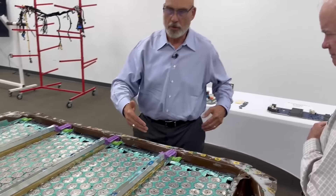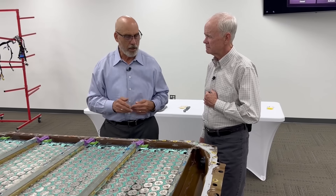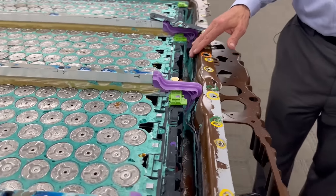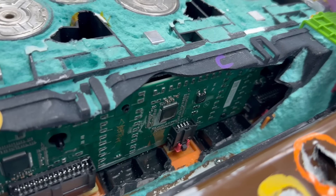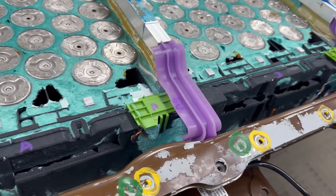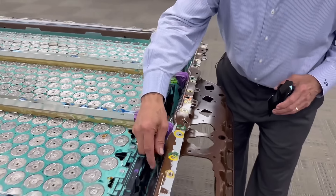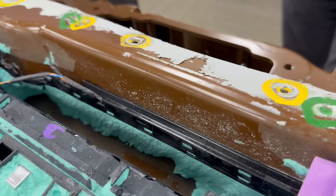All the batteries have sensing modules. It's important to know the state of charge, the temperature, the state of health of the batteries — both charge and balance. Each one has a battery sensing module. You can see inside the electronics, the ribbon connectors that connect all these things because they all have to talk to each other. The funny thing is that in this case, with all these batteries, the weakest one sets the pace. So when you start getting weak ones, they start to drag the whole thing down — you can't go any faster than the slowest part. There's a trough that comes along here and these wires are routed through it to get all these things to the control modules.